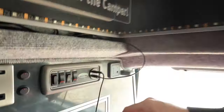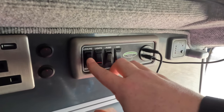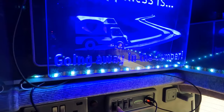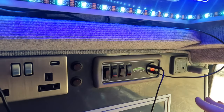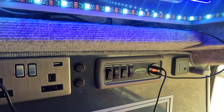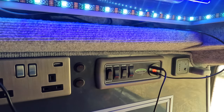What we use is this section at the back. You've got a switch which means you either get power from your leisure battery - you see those lights went on - or you get power from your vehicle battery. You would hardly ever use the vehicle battery because you'll flatten it and you won't be able to drive off anywhere. That is only for an emergency in the middle of the night if your leisure battery is gone.